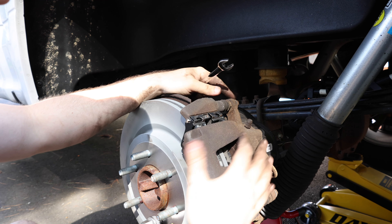Now we just need to put the parking brake back out of service mode. Key on, turn the ignition on, foot to the floor, apply the parking brake, then turn it off. Within five seconds turn it back on and you'll hear the parking brake apply itself. That was it — it's a hot one out here today, glad to get this done before it gets too hot. Parking brake is working again, brakes sound good when I'm driving it, they're not scratching. Thanks for tuning in to Smacky's Garage, I'll see you next time.